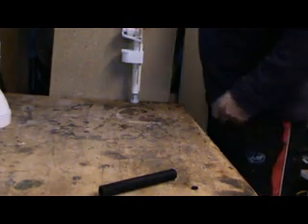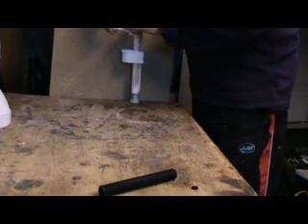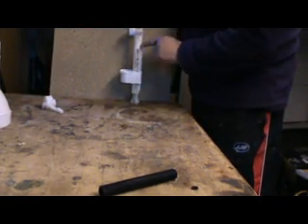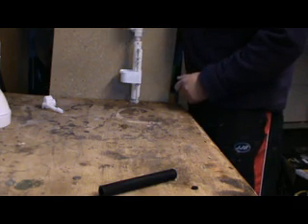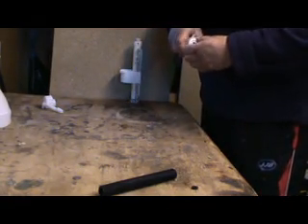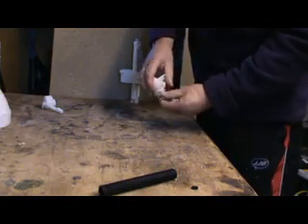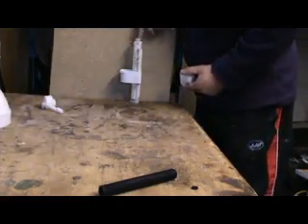But there is a little trick I've found. Undo that bit — there's a washer inside there so I won't lose that. Take the float off like that, then this part will separate like that. Then the top will turn, so you can get those bits out. That top part will come off as well with a bit of effort. And there's a little diffuser inside there — you can give that a blow to clear it. And that's where the main problem is, inside there.